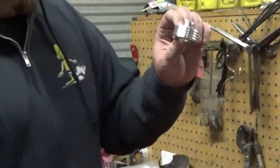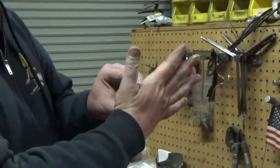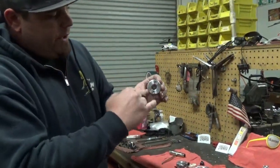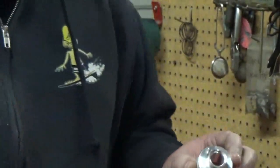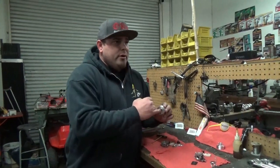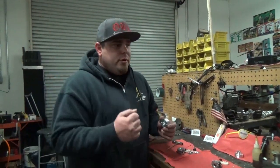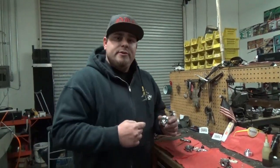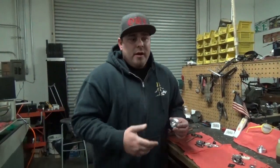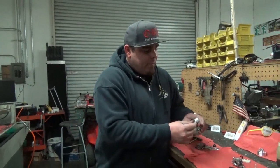It's designed so that when you put it on any kind of foam filter or clamp-on filter, the horn will never stick out farther than the rubber — so if your filter takes a smash from the side, it will not block this and it will always stay open. The opening at the top is a little bit bigger than the opening at the bottom, and what that does is as the engine cycles it eliminates a dead spot in the intake track. Having this taper and bore gives better pressurization through the case and through the pulse of the engine. In simple terms, when you get off the throttle and back on, this helps with response — there's no lag.